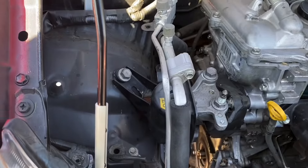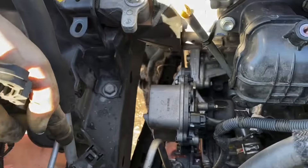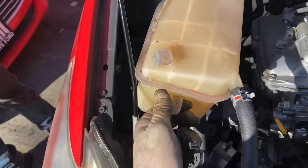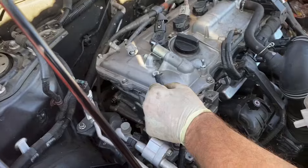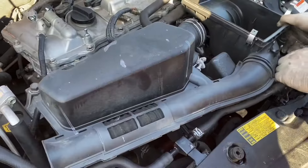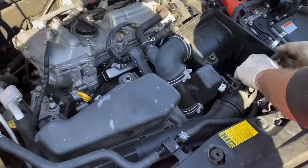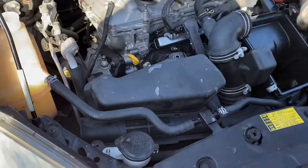Don't forget to redo these three clips and attach it up top. Now it's time to start getting the small things. Don't forget this bracket with a nut and a bolt — it's going to attach to the engine mount and hold this back in its place. Ground wire. Next is the air box — just place it on, going on the opposite way that you took it off. Get the bolts: two in here, two right there, then we'll put the air filter on.